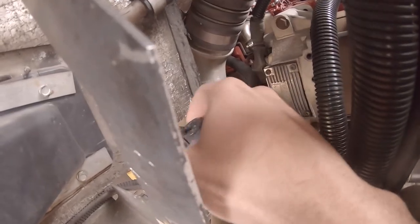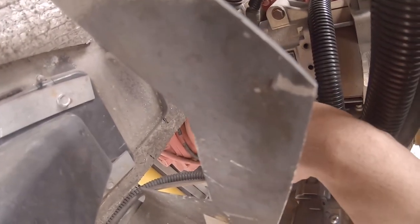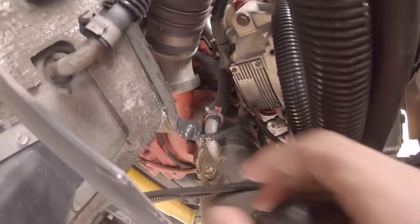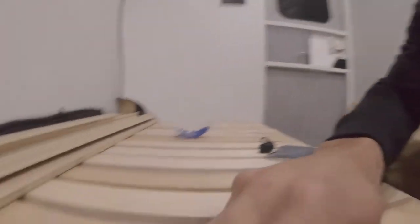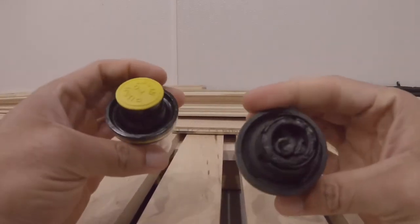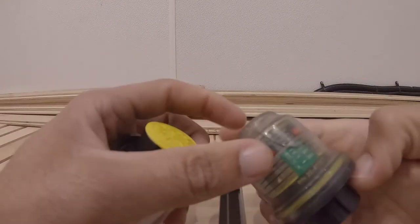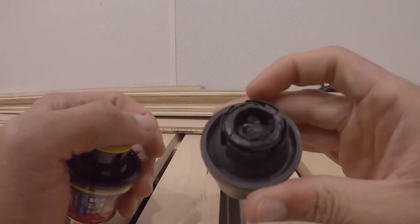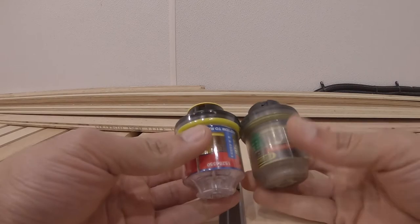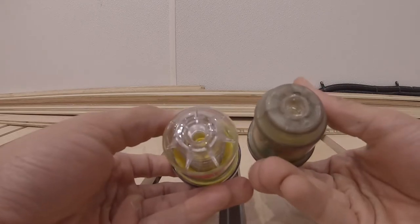There's a little o-ring, a little gasket in there that should help seal that up. This is the old one — as you can see it might have melted or cracked. I did install a turbo blanket to keep heat under the hood down, but being cracked like that could have been letting dirt in. I'm not sure if that's actually sealing or if it might be letting some air in. But this is the replacement — it's a Freightliner/GM part, same thing, the part numbers match up. All you have to do is screw in the new one.